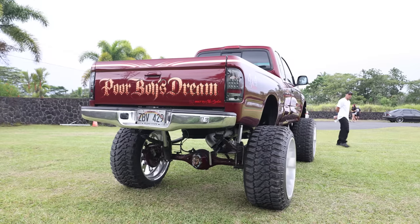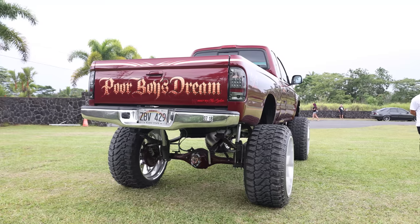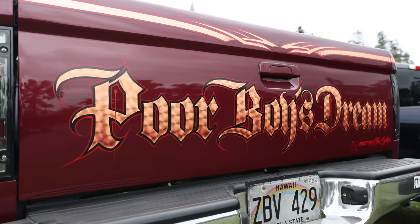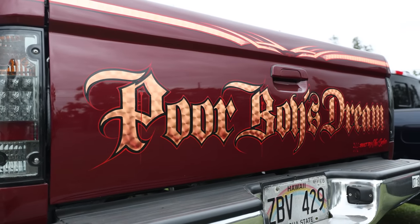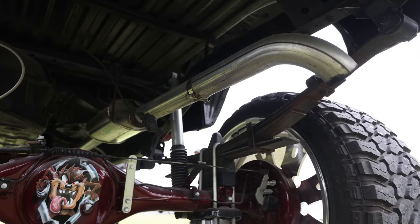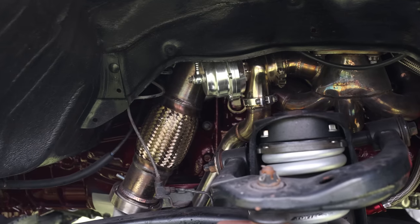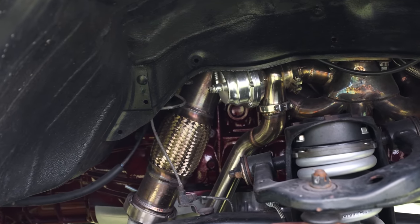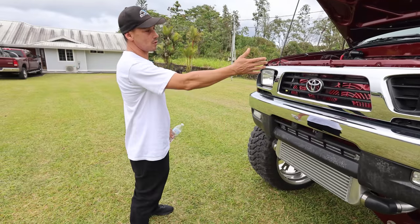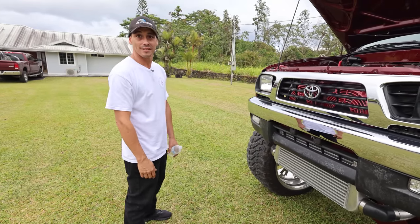The fact that you're able to get the speedometer to work correctly and accurately — yes, the speed. And on top of that, the tach, everything, all of that works. Including the warning lights — check engine light as well. I had it specially wired for that, so if a trouble code comes on, it'll go on like a normal car. You just plug it into the OBD2 port.